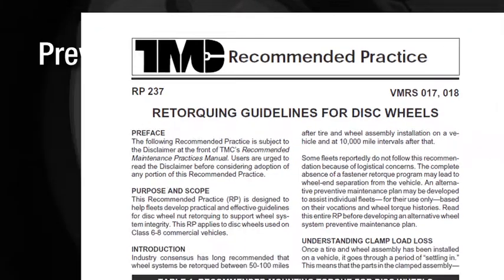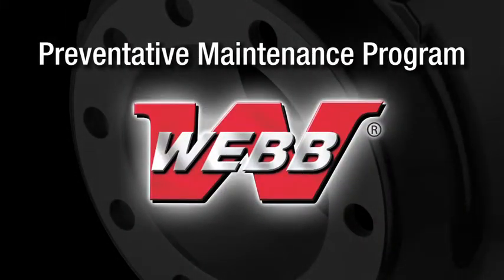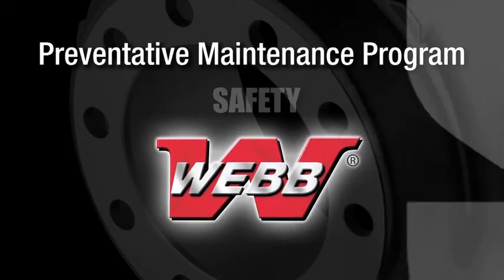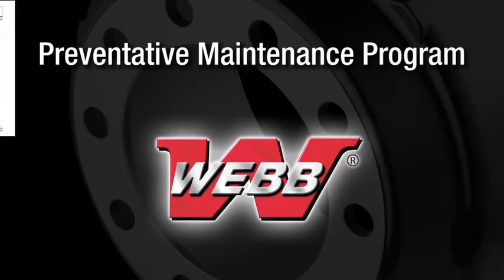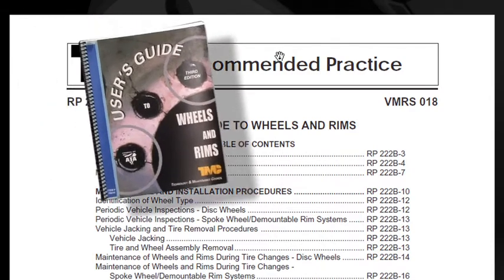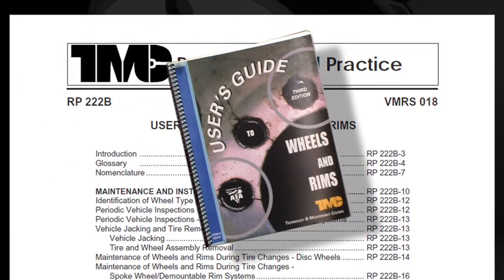It is recommended that a preventative maintenance program be established to periodically check for wear, damage, proper nut torque, wheel alignment, cracks, and leaks. Such a program will help ensure maximum performance, service life, and safety for the life of your Webb wheel products. For a comprehensive list of additional wheel end configuration installation guidelines, please refer to TMC RP 222, User's Guide to Wheels and Rims.